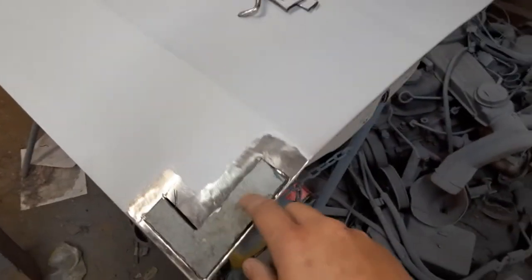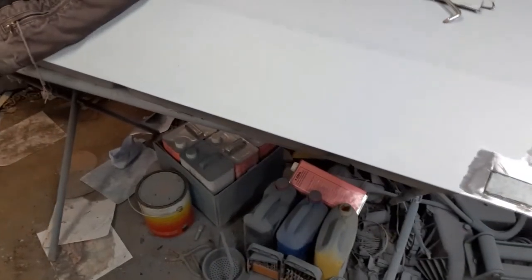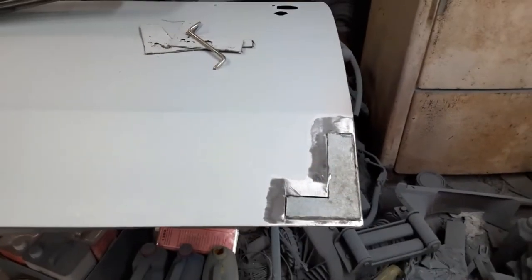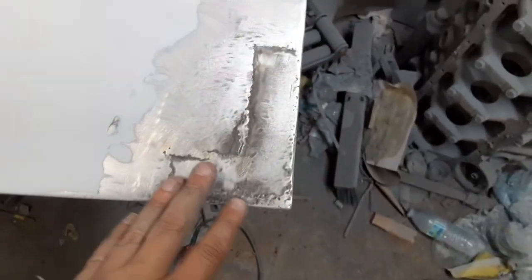It makes this the blue door, right? Because there's a piece of the blue door in this door, and there'll be a piece of the blue door in the other door. So that means I restored these doors. As I kind of showed you, I cut some metal out of the other door after cutting this out, and I have now welded that in.